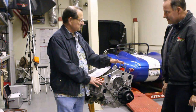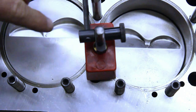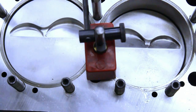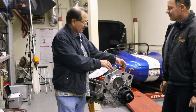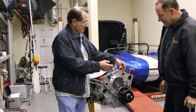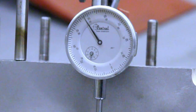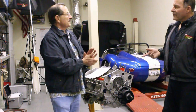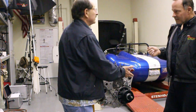Unlike a cast iron block, this magnetic base really only becomes magnetic where the two cylinders come together and are tangent — that's the only place with a wide enough perch, with the width of the two sleeves coming together, to get enough magnetism for a decent hold. It's not a perfect magnetic hold, but we're only trying to ballpark it, so being off 2 thousandths is fine. We're making sure we're not off 50 or 100 thousandths.